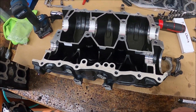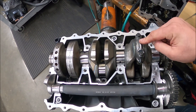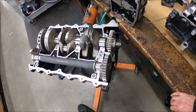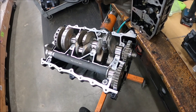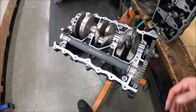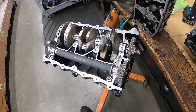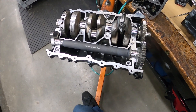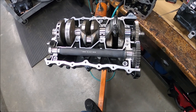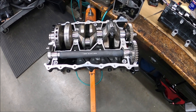To summarize: you want to check your axial clearance on the crank and counterbalance using thrust washers, check axial clearance on all your rods, check radial clearance on all rods and all mains, and check radial clearance on the counterbalance. That's the quick and dirty way to do it. If you have a micrometer and a dial bore gauge, you can measure the case bore together, subtract your journal diameter from the bearing size, and that gives you your clearances. Plastigage does a very similar thing and is actually pretty accurate — close to what you'd get with a dial bore gauge and micrometer for a stock rebuild.